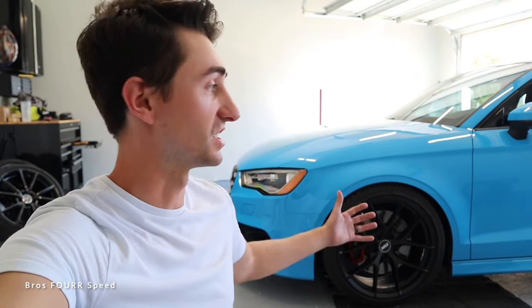This strictly adjusts the steering wheel's position relative to the wheels. Since I did it evenly — one full rotation toward the left on both sides — it doesn't affect the alignment negatively; it simply straightens out the steering wheel. I had the same issue with the GTR after wheels and springs; the alignment came back a little crooked. Now I know I can fine-tune it at home without wasting the shop's time. That is how you straighten out your steering wheel at home on jack stands — super simple, and more effort getting the car up than making the actual adjustment.